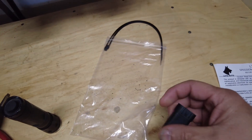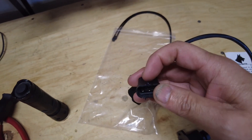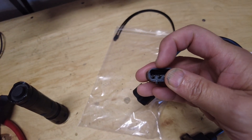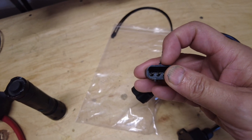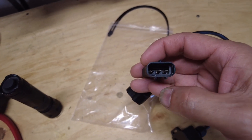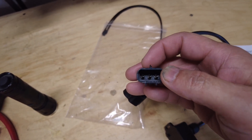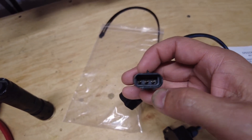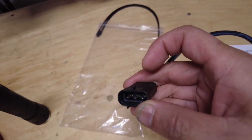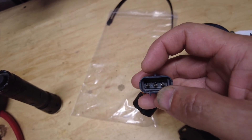What I did find when I first was crawling underneath was that this particular ridge right here needs to be trimmed off because it doesn't line up with the factory plug. I emailed Brian at Lutz Auto and he told me that should have been nipped off with a razor prior to being shipped out. So you take a razor blade and nip that little tab off and you're good to go.